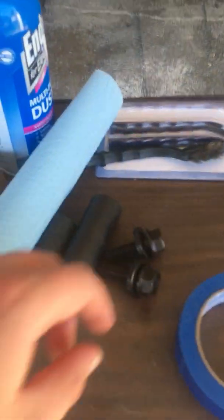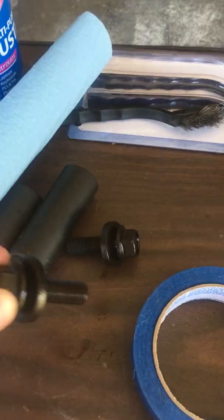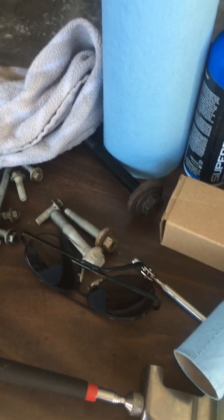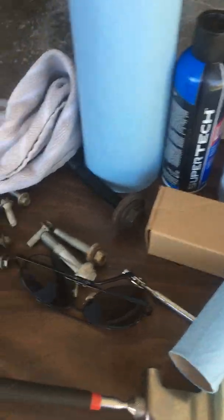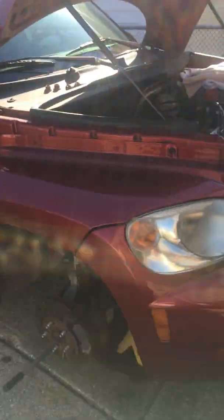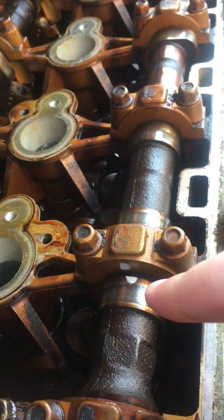You can see that these are the intake sprocket bolts — these just get thrown out. This is the crank bolt. I'm probably going to put that one on and start the motor up just to see that I've done everything right — I'm not going to leave it on there. At this point, I am at the point of reinstalling the cover. I've cleaned all this — the sealing surface is going back on shortly. I made these little marks to know exactly where my cams are supposed to be.